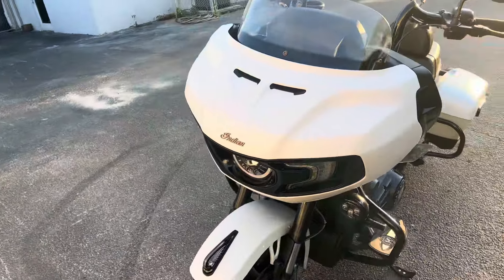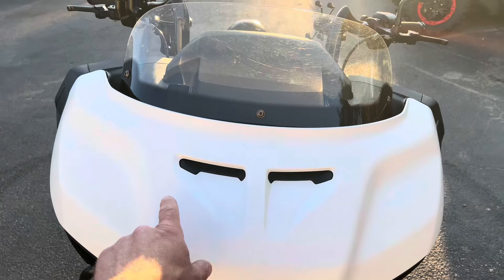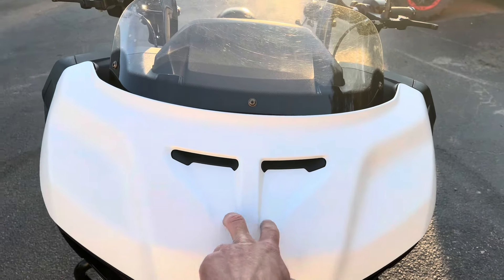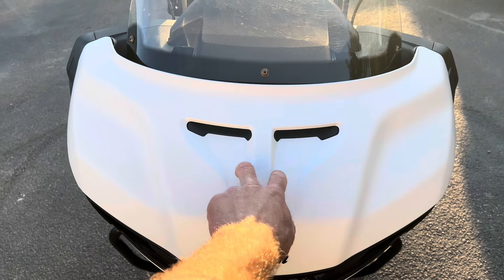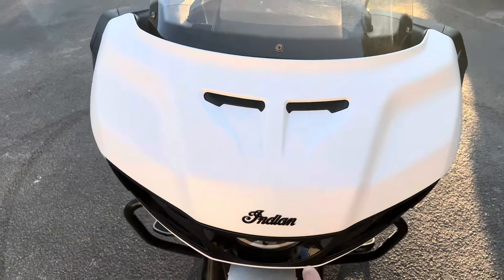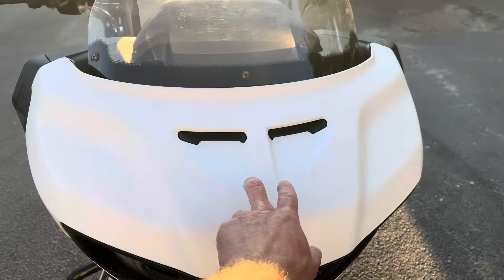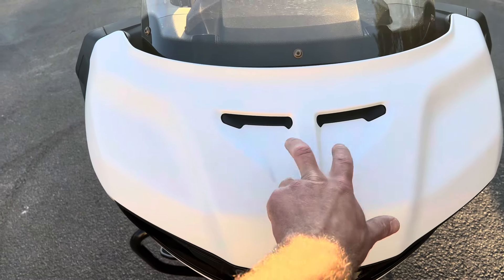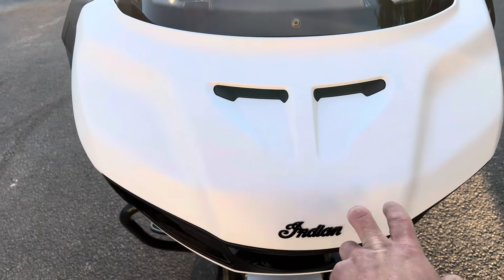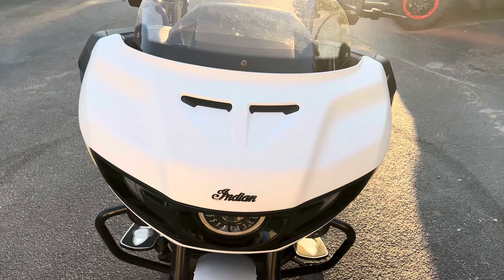In the fairing, this is where we switched it up. We have dual amp power and ground here — we ran 4-gauge power and ground all the way up into the fairing. We have distribution blocks that convert that to two 8-gauge outputs that are fused up here. We have a fuse down by the battery that protects the 4-gauge, but when you go from 4-gauge to 8-gauge, you have to have distribution here — especially fused — to ensure that the 8-gauge wire is protected as well. We'll do a whole future video on that.